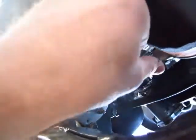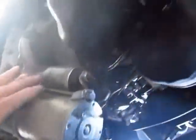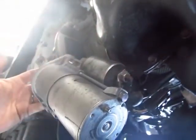I thought I would have to move the bracket — the bracket that goes from the block to the intake there. But luckily, what I did is I put the starter back in its place and then lifted the back end up and tilted it so the gear comes down first. And then there's a clip here — a little wire connection. I think it's a 12 millimeter — yeah, it's a 12 right there.